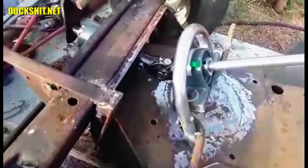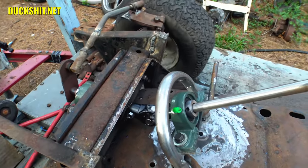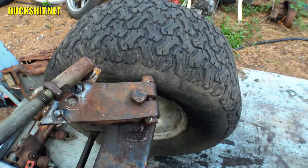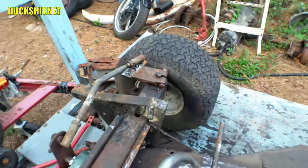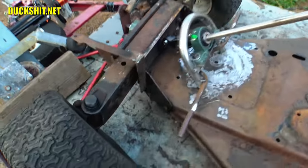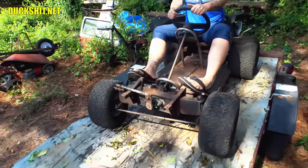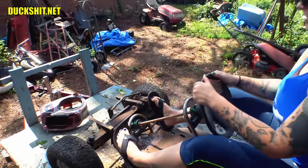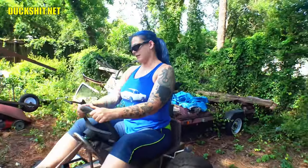Everything fits nicely and it seems to work well. I cut the tie rod down to make it fit on the new steering rack. I left the angled bend in the tie rod deliberately so it clears the front suspension components when the front rocks. On this mo-cart, the curved tie rod probably won't be a weak point — it's probably just as strong as most full-sized automobiles. I added the front axle from a clapped-out Radio Flyer wagon as a set of foot pegs for the mo-cart, and it fit in there quite nicely — almost like it was meant to be. This should make a nice easy pivot point for your heels on the control pedals.